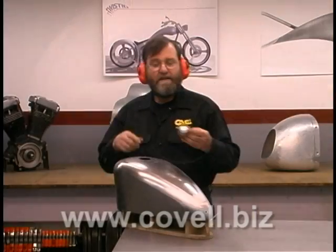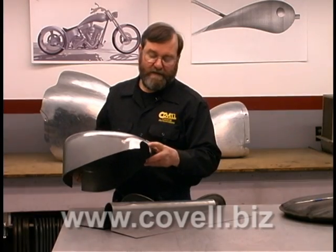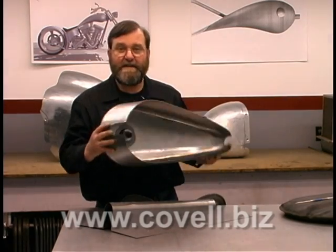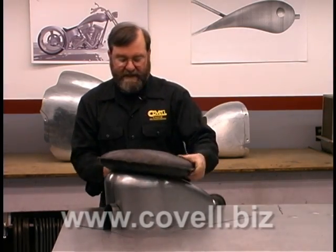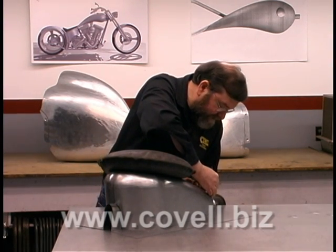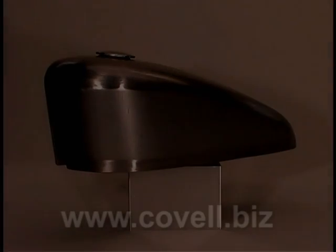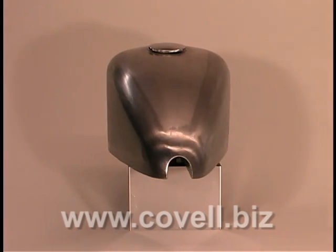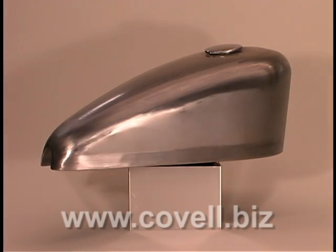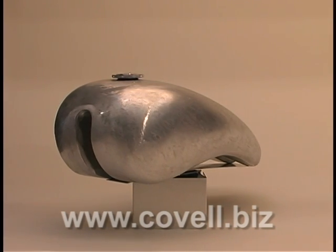There's our hole for the cap. I'll be using a bung that I cut out of an existing gas tank, and that fits neatly into the hole. We've cut out an opening in the tank in the front and rear for the tunnel, and the next step is to place the tank over the base and tunnel. I'm going to use a sandbag to weight the tank and hold it tightly against the base, and now we'll scribe on the tunnel and base to mark where it's going to be trimmed. Here's the gas tank — completely welded and sanded smooth. You can see it has a nice flow of contours and should make a very nice addition to a chopper-style motorcycle. This is the end of part one. In part two we'll show you how to mount a tank, how to make a more curvaceous tank working with aluminum, and how to test your tank for leaks.